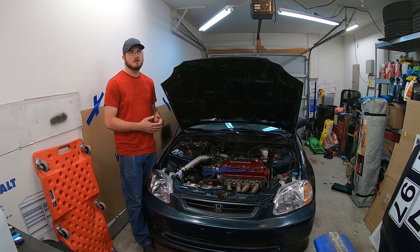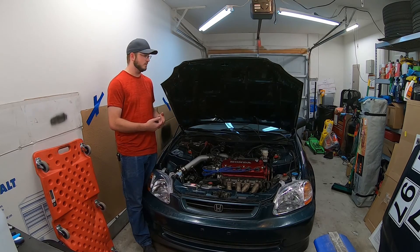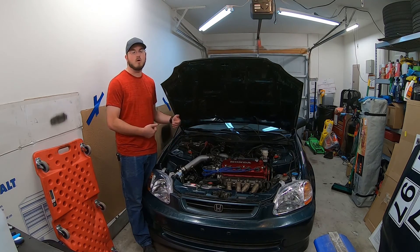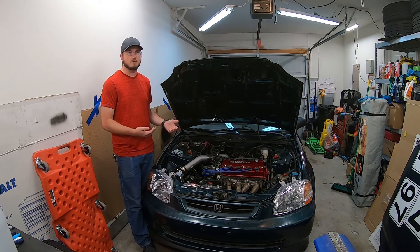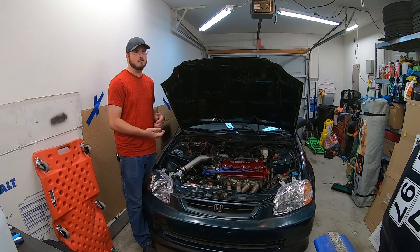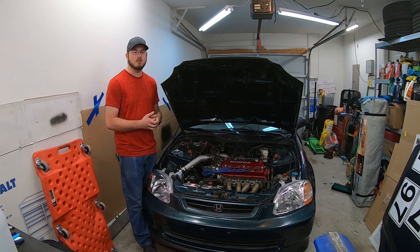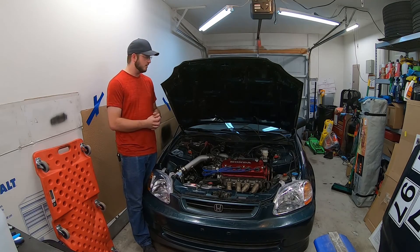The downside is that unless you've had your rotors coated specifically with a special coating — and I believe you can find that service at high-speed labs if you search online — it will eat into the coating and wear off the rotors eventually because of the steam it creates from the heat. It's a trade-off I was willing to make. I use this car for autocross, so having as much power for those few seconds is important to me. Eventually I'll get the blower rebuilt and get the rotors coated.